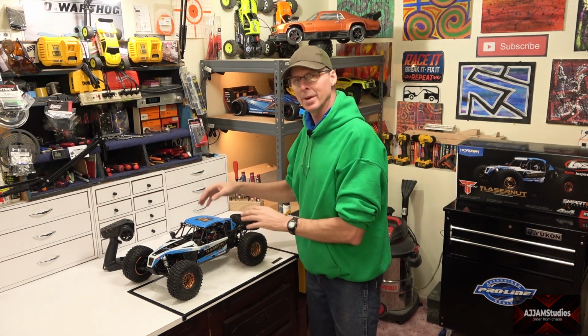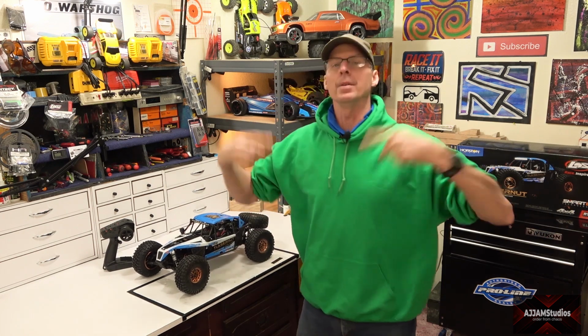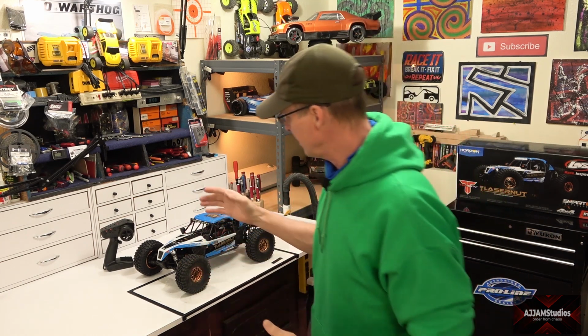I don't like it when I punch the throttle and it sits. These lighten up a little bit, and then all the power goes to the front. It spins these out. The tires grow up in size. That's letting you know that you're losing the power to the rear wheels and transferring it to the front, and you're wasting all that energy at the front of the car.